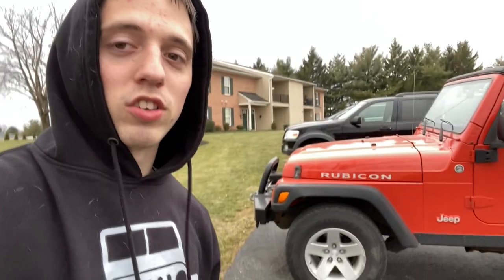If you watched my last video, you might be wondering why I'm doing a mod to this Jeep after what I said, but an opportunity came up. We bought a lift for the Jeep for $25. I'm pretty sure it's 2-inch blocks for the coil springs. I don't want to do a body lift, so I'm glad it's coil springs with shocks and adjustable track bars. So the Jeep is hopefully getting lifted. Hopefully it goes somewhat smooth.